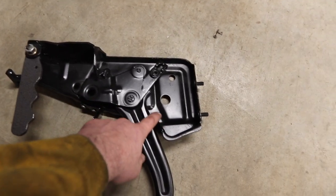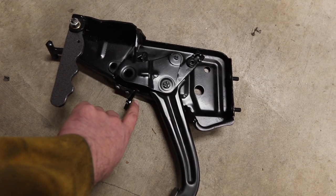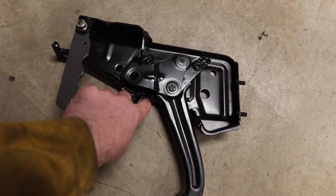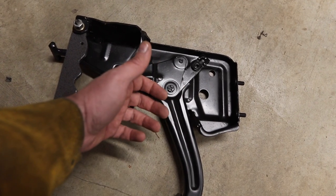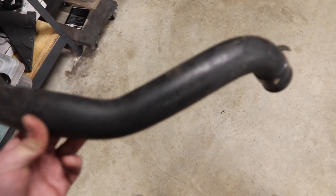I also modified the parking brake assembly. It had a really goofy parking light setup, so I welded on a tab with a weld nut so I can just screw in a normal door jamb dome light switch — that's my new parking brake light switch. Much cleaner, much more serviceable setup. While I'm over here, this is my radiator hose and the label is long gone. If you've got a custom application, make sure you write your radiator hose numbers down, because that's off of a Ford something or other. I found one photo that had the label on it, so luckily I'm able to get another one.